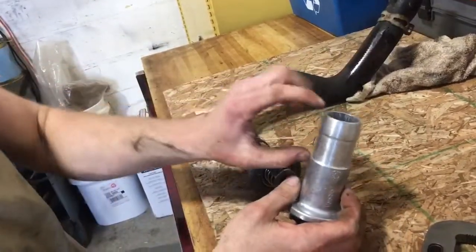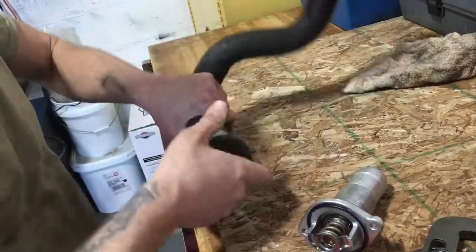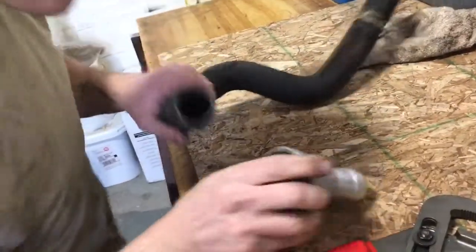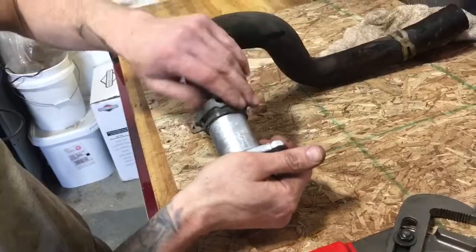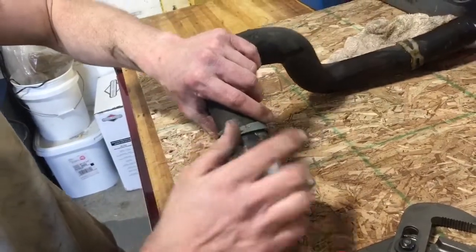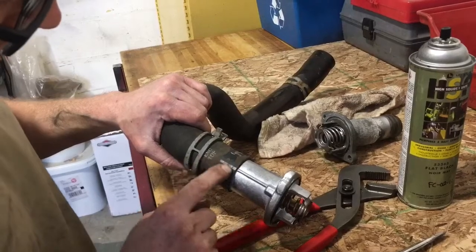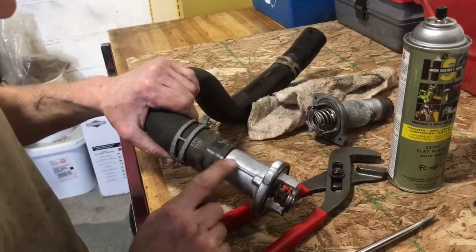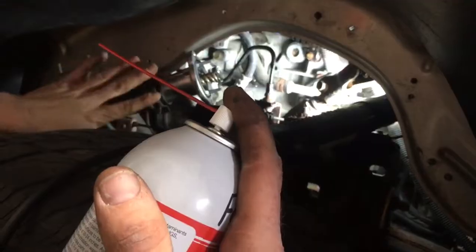As you can see, the thermostat goes about two inches up into the hose, and that'll pull off. Clean that up, then it's simple — it goes all the way back in. Squeeze the clamp a little to release it. When lining this up, there's a white mark on the factory lower radiator hose that lines up with the mark on the thermostat housing, so you can get it all set up before going back to the truck.